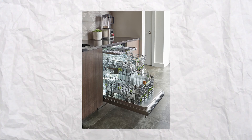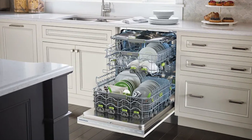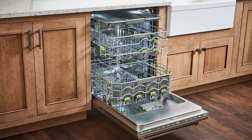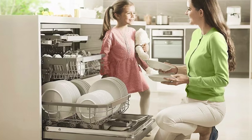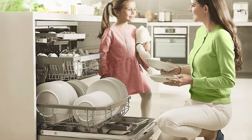Blocked Water Inlet Filters. The water inlet filters prevent mud, debris, and dirt from entering the dishwasher as it fills up with water. Once the inlet filters are clogged, the IE Error may trigger to indicate the pressure and the amount of water flowing into the dishwasher have reduced.